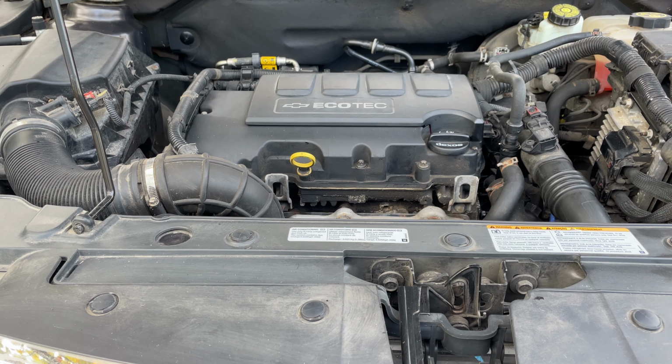So that is how to replace your oil with the OEMTools fluid extractor. It only took 10 minutes to extract all of the oil out of my vehicle. You may have different experiences if your weather is not warm, or if you don't warm up your vehicle prior to extracting the oil. It's really important to do that step, otherwise the oil is too viscous to vacuum very quickly. But really only 10 minutes to get all the oil out is really not bad at all, and it's a pretty clean way to do it as well.